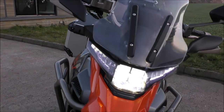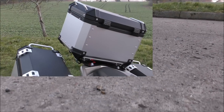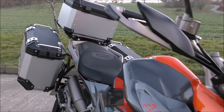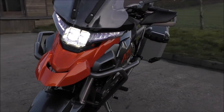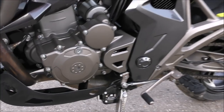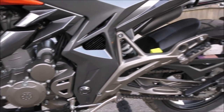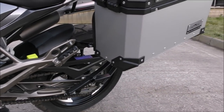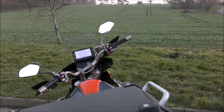These bikes have two different modes: eco and sport, and they use different mapping. Eco mode is ideal for touring. However, if you rev up to 7000 RPM it will switch to sport mode, because it'll recognise that you're being a bit more aggressive with the acceleration. Then, once you release the throttle and the revs drop, it'll switch back to eco mode by itself. That's pretty cool.